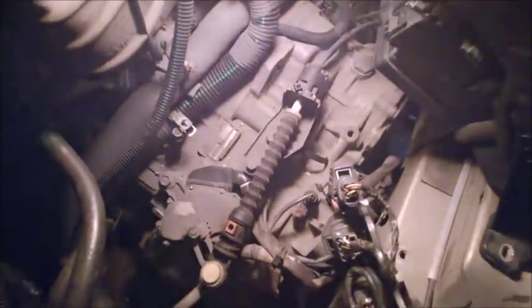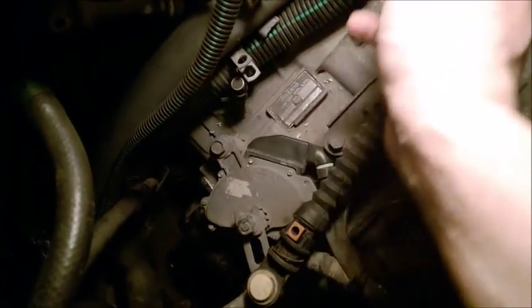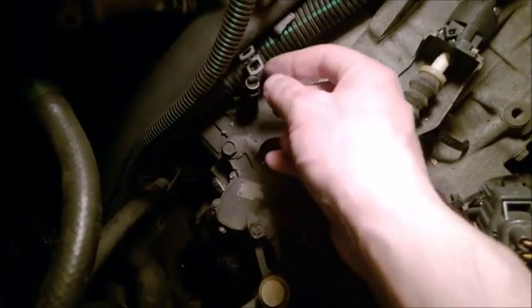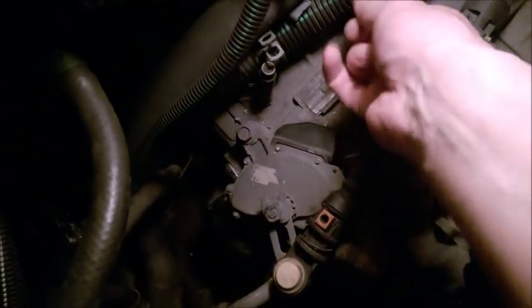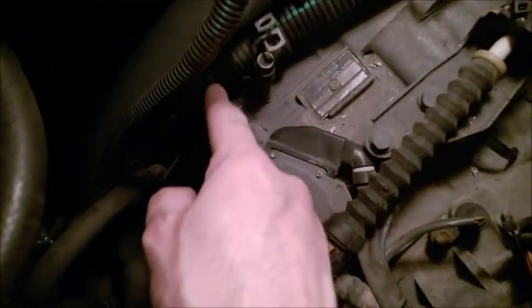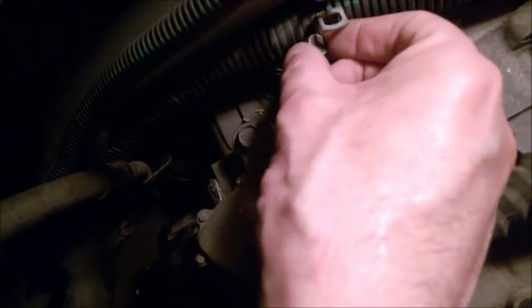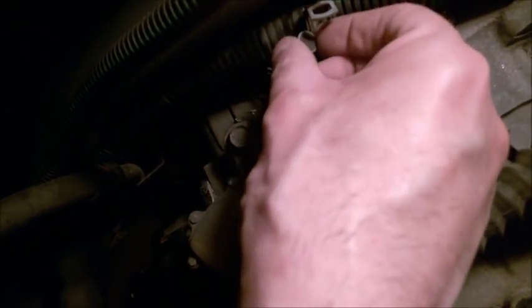Then this is a radiator hose, the lower one. There's a bracket on this thick cable. I did undo the bracket, and I actually got the cable out from the bracket, slide it underneath the hose. Just go underneath, careful, this is a bleeding valve for the transmission. Watch out so you don't break it. Don't just pass the cables on the side of it.